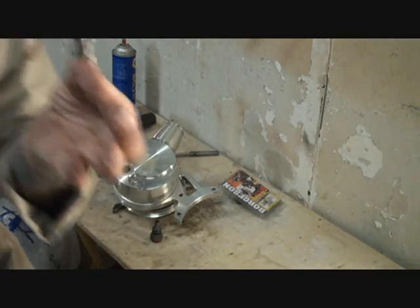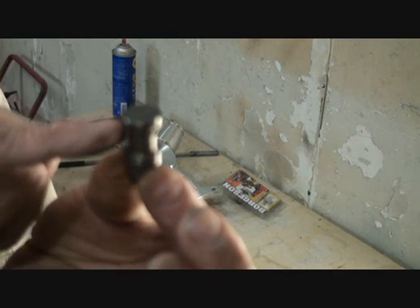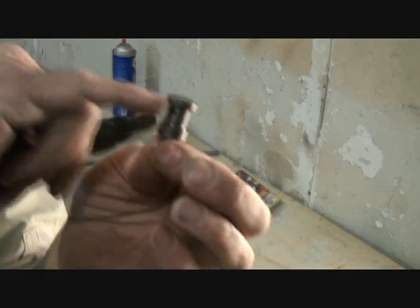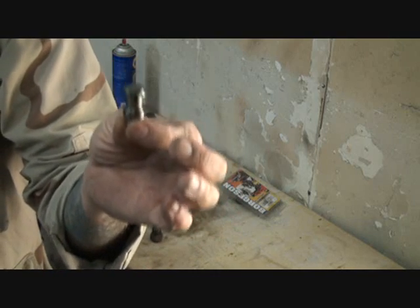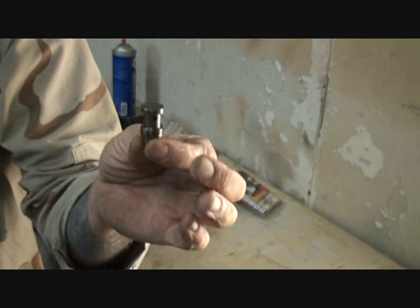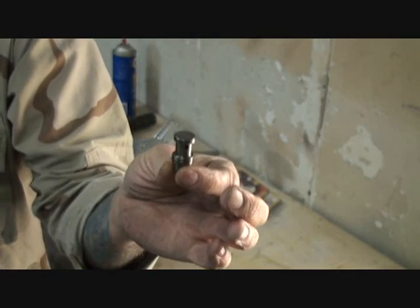Now, what's important about this valve is it's a machined valve. If you look at the sides, that's hardened steel, and it's got little ridges right here. Fluid actually literally runs through those ridges. Did you know that, BP? Never seen this apart before. This is a pressure valve. This is the valve that regulates the pressure for your power steering pump. Now, what we're going to do is deregulate the pressure so it doesn't have such high pressure. Do you see what I'm saying?